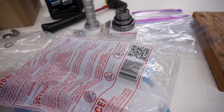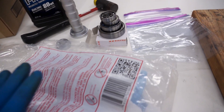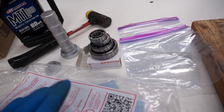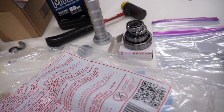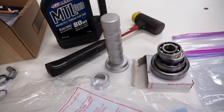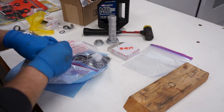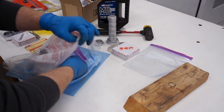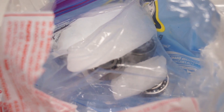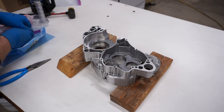While the crankcase is heating up in the oven I'm going to cool down the bearings. I'm putting them in a zip-lock bag along with dry ice — this is about two dollars worth at the grocery store. Make sure those bearings are in direct contact with the ice to cool them down quickly. Also have a hammer and a punch setup ready in case they don't go in right away. You hear that squealing? Those bearings are cooling down pretty quick. All right, the case is up to temp — we're going to have to move quickly.